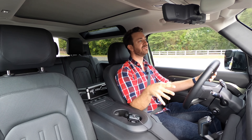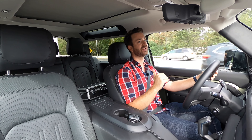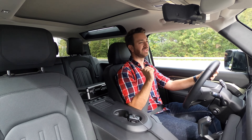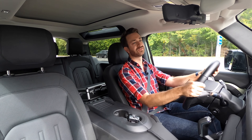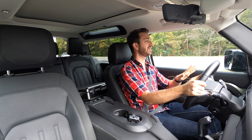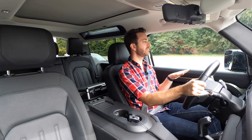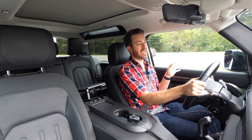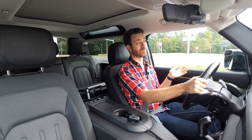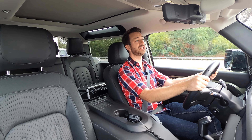Overall, this is a fine tow vehicle. It is absolutely good enough if you're going to be doing an open flatbed trailer. If you've got a trailer that's enclosed like this, I would just really hesitate to recommend it — I would much prefer seeing a Defender 110 towing a trailer like mine instead of a Defender 90. It's doing it, it's fine, but this is a very lightly windy day and I've got no one around me creating wind wake, and I'm not going 65 or 70 miles an hour. For the sake of everyone's safety, we're not going to go on the interstate and do that, because I really think it would be sketchy at best.